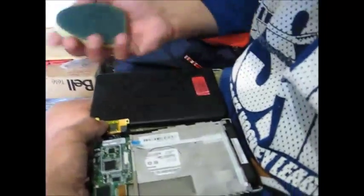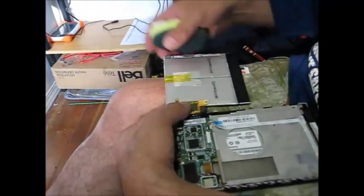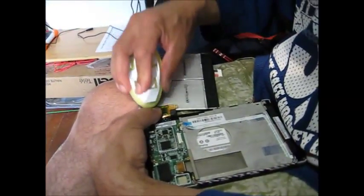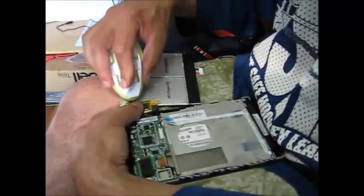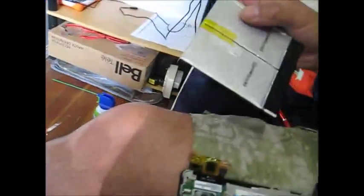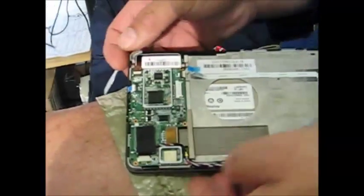Take your Teflon sponge and just gently clean this off. Because if you've got any kind of grit in there it'll give you a really jumpy input. Put this in, gently move it into position. Take your pry tool and push it down in there and it'll sit right in there. Then you just pop that down. Done — digitizer is in, everything is all clicked down.